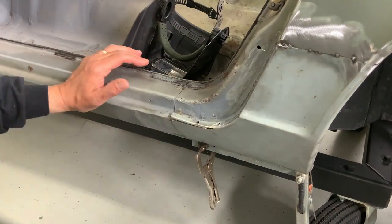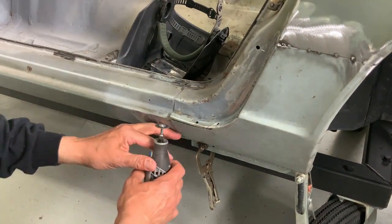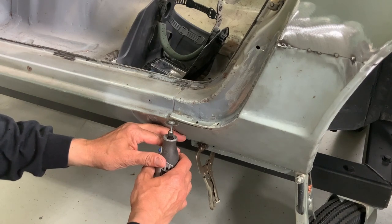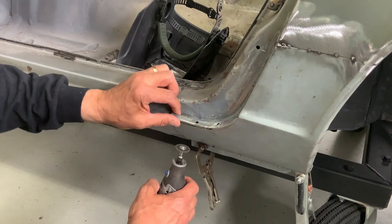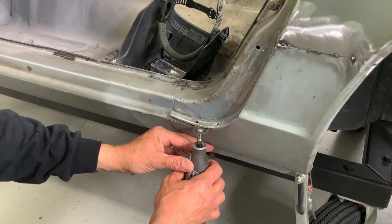Running into the quarter panel here, I couldn't really move anything, but the bottom edge sat about a sixteenth of an inch high. So I used a small Dremel with a cutoff wheel and cut a slot in it, which I'll then hammer back down and weld closed.